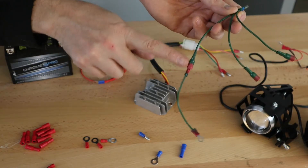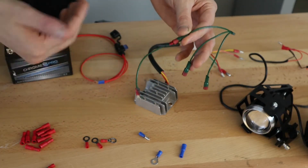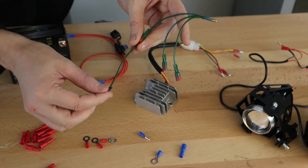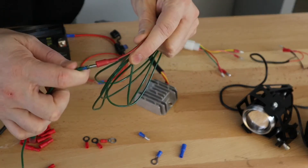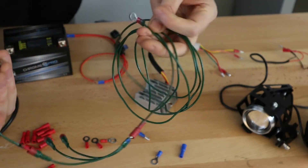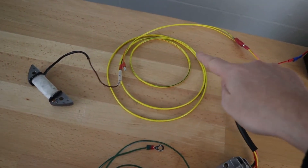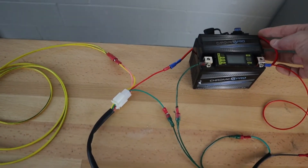This brings us to our grounding harness. I have one of the blue male connectors that ties together three wires. You can sort of ignore one of them if you like — I put that in there just so I have a really good quick disconnect from the battery directly and can change out the battery if needed. With the male coming in, I have two females coming out and one eyelet connector that bolts directly onto the battery. The wire going to the engine hooks into that blue male connector. It's really nice that you can run these lights without the engine running, or flip the engine on to charge the battery.